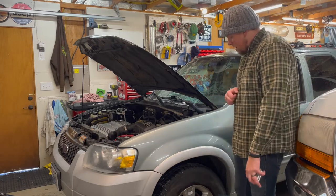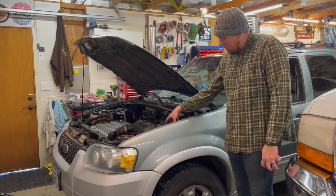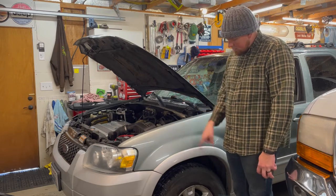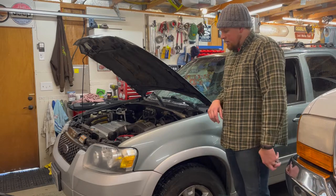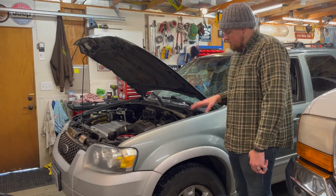So anyway, I'm going to pull this thing apart real quick and slap this thing in. We have to pull the whole shock out, but it's 4 bolts up here. They look just like these ones on the spacer. And then it is 2 bolts on the knuckle, and that thing should come right out of there. I'm not going to film this whole thing. I'm just going to put it together, and then I'll get you guys some measurements at the end. I might show you a little bit. I'll come up close and show you what I'm taking apart.